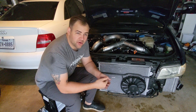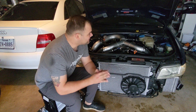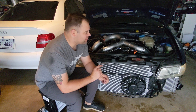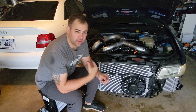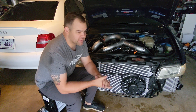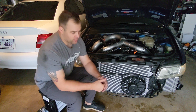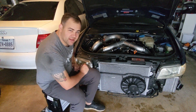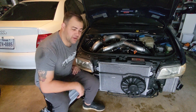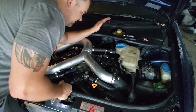It's a new day — a lovely rainy day here in Virginia. We got the car put back together yesterday, got it on the road, did some test driving. I think I need to bleed the clutch again. I didn't pull the transmission or the clutch line, so I thought it would be okay, but maybe there was some residual air from the previous time I had the engine out. I'm going to use my trusty Mighty Vac to show you the best way to get all the air out of your system.